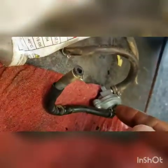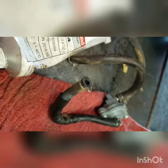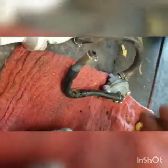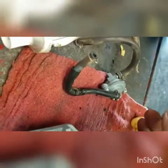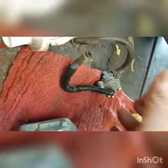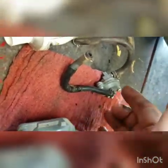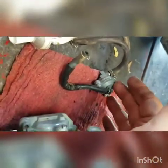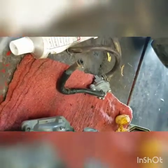This just enrichens it. When you're going at speed and you let off the throttle, you hear bikes backfire — pop, pop, pop. This enrichens the mixture. Being too lean is what makes it backfire, and everything's lean due to the EPA. So another way they get around making them too lean from the factory, they add this — it adds fuel on deceleration to take away the pop or make it a lot less severe.